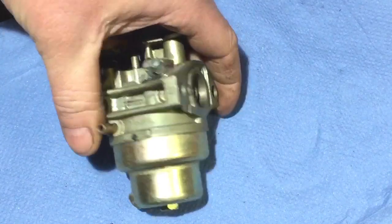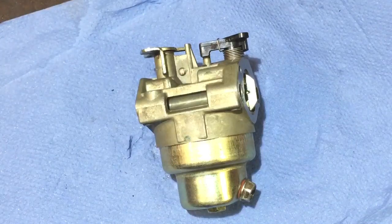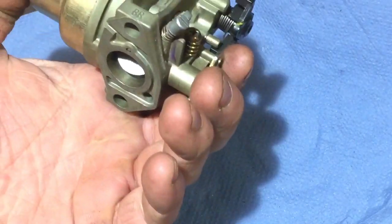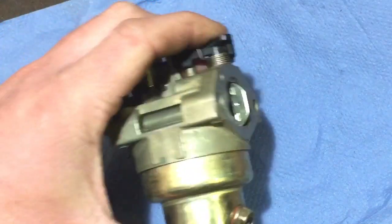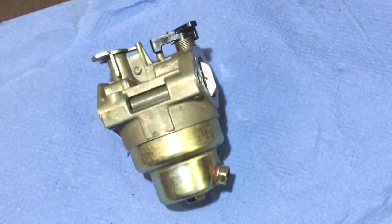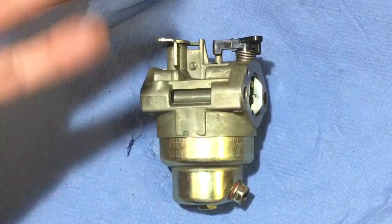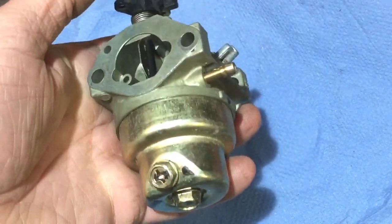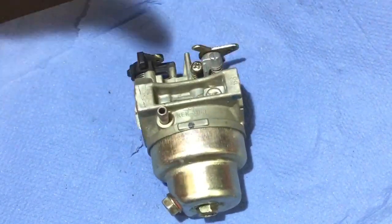And there we have it — one Honda GCV carb all cleaned and ready to put back on the machine. That's how I do it manually. I don't use an ultrasonic cleaner every time, but if it played up I'd take it apart again and put it through the ultrasonic cleaner for a deeper clean. This one wasn't particularly dirty so I don't think it required that. If you do this and then ultrasonic cleaning and it still doesn't fix it, it's more than likely something is wrong inside the carb and you'll need a new one. Most of the time you can clean them a little and they'll be fine. Thanks for watching.